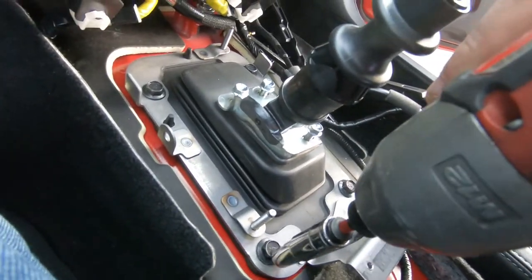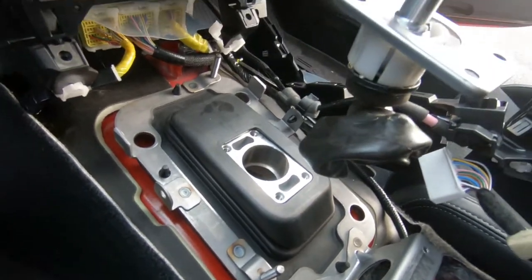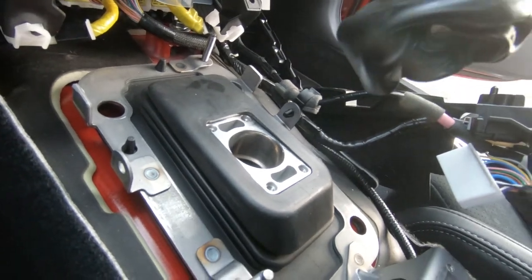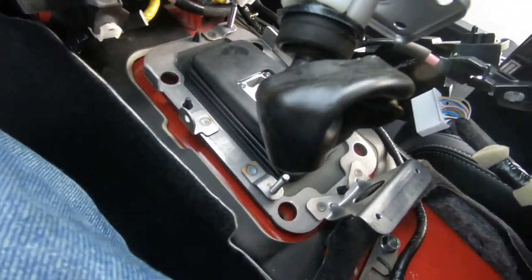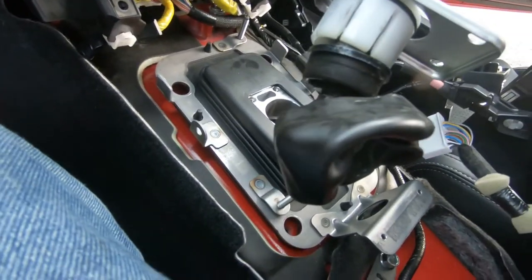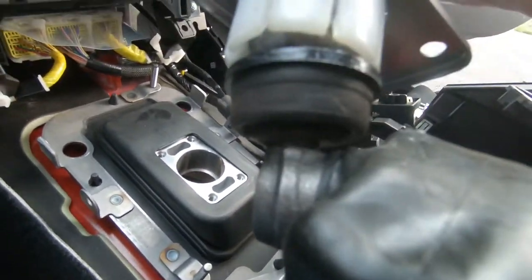The shifter stop uses three 10 millimeters, and the whole bracket — those black bolts are 12s — just zap them all out. Before you can pull the entire bracket out, pull the shifter through first. I bought the hardware kit, so the only thing I have to transfer over is the shift boot. Otherwise you'd be swapping over the boot, the pivot clip bearing, the bracket, and the bottom bushing.